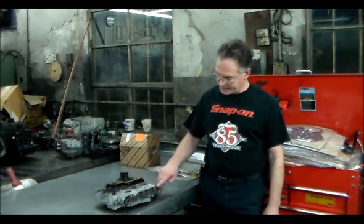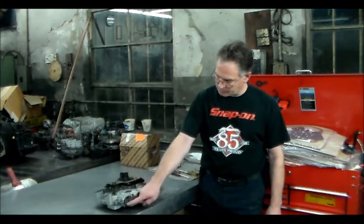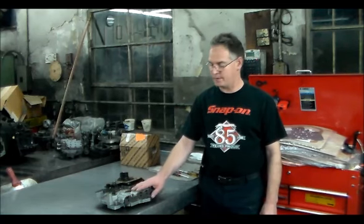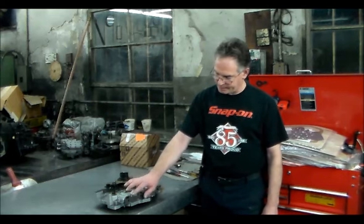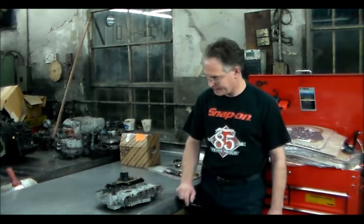So this plate is pretty common to crack because, you know, this one cracked off here. This bolt was loose. This thing flexes because I guess the metal's not that thick. So it flexes, and as it's moving and flexing, I guess the bolts are coming loose, and then it totally just broke this off. It cracked here and bent.